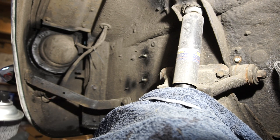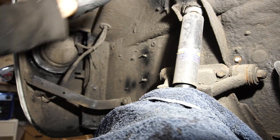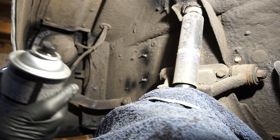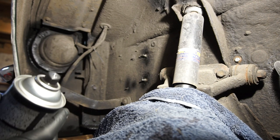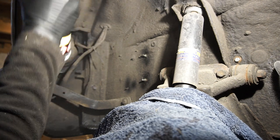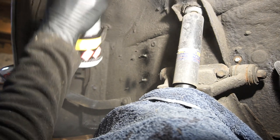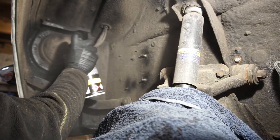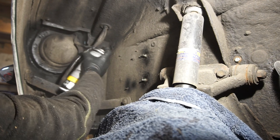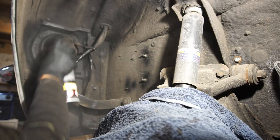It's been a couple of minutes and I've hit all those areas twice now for good coverage. Now I'm just going to do a light coat everywhere. Most of this inner wheel arch is in really really good shape — the old undercoat is stuck on really well — but if there's a small crack somewhere that I haven't found when scraping, a light coat of this will creep in underneath and help protect the metal in the long run. For areas up near the light, just try to get the can in there and spray up as far as you can. It doesn't matter if you get runs — you just want the stuff everywhere.